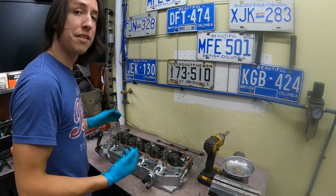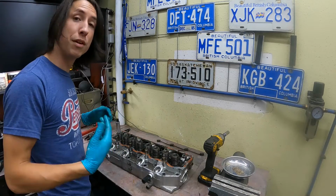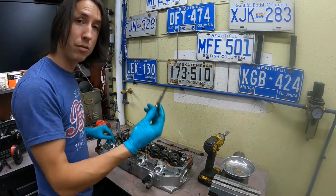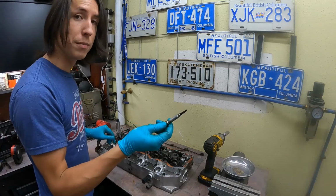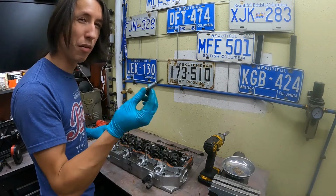If you're finding your van has a hard start on cold days or smokes or runs rough, it might be advisable to replace the glow plugs anyways. If you do replace them, go with OEM Mitsubishi. The NGK ones just don't work quite as well.